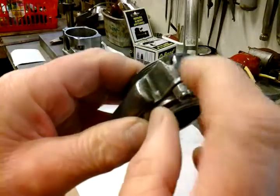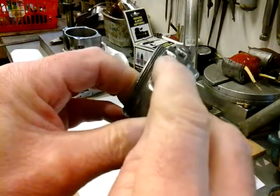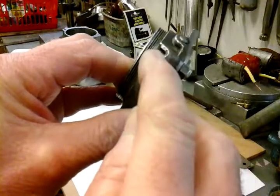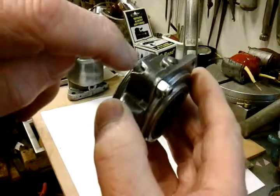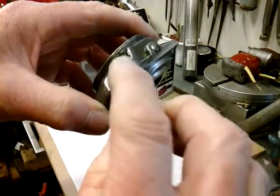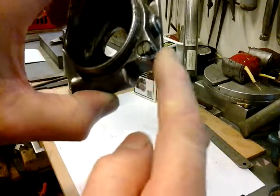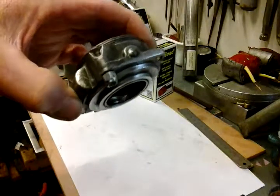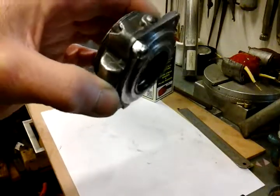So what I'm going to do, I'm going to put the Q-Bond powder and build this section up round here till it's full. And then I'm going to take the nut off, and hopefully this screw — the Q-Bond will have made a thread, a sort of threading on the inside. This screw should then screw out. And then I can reshape the Q-Bond round that area there, reshape it back to match the casting. So I'll update you on this when I've degreased the part and set up for my Q-Bond.